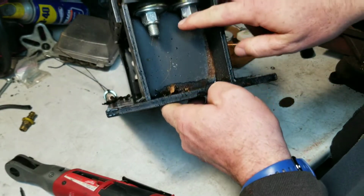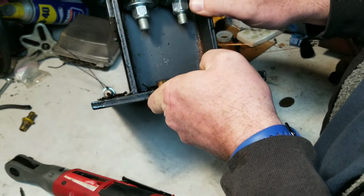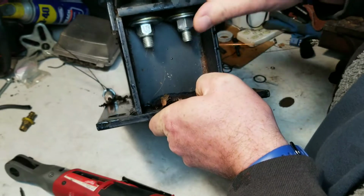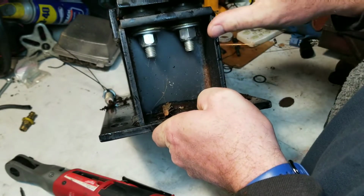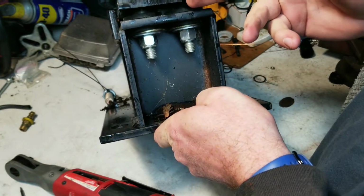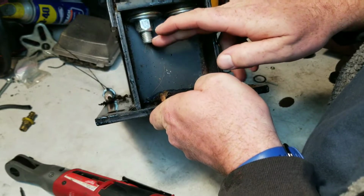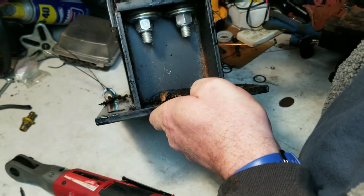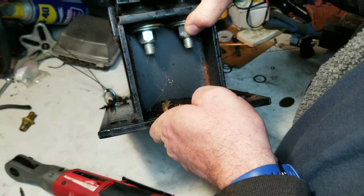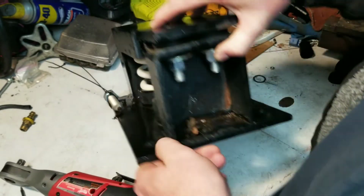If you look underneath here, you got those two bolts. I can never remember what they're called, but they're the shipping bolts, and they're always completely clamped down in shipment. When I'm doing installation, I loosen these guys up on the bottom thread, and you really can't get anything in here. There's probably about 16 of these on a generator.